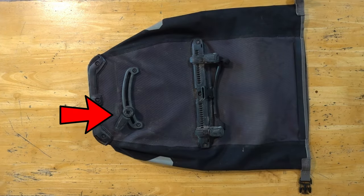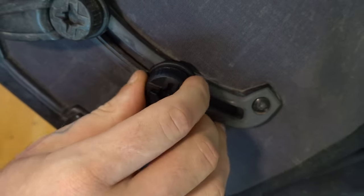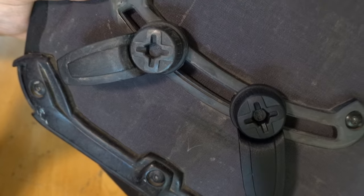While you're taking all the bolts out to put your thread locker on them, it might be worth considering adding a second pair of lower hooks. The single hook at the bottom of your panniers does a pretty good job of holding them in place, but on really bumpy roads it can get a bit overwhelmed. It's really simple to just buy and add a second hook, which will help keep them way more stable. Ortlieb have even done this themselves on their gravel panniers.